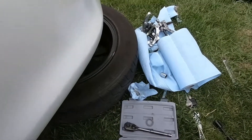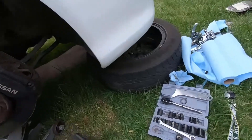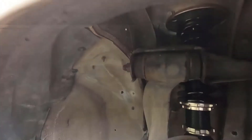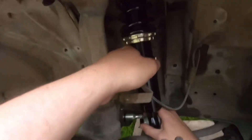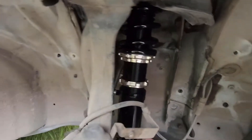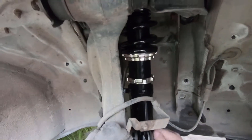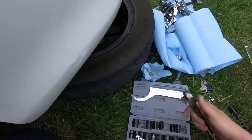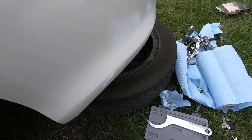Here I am installing the rear of the bottom — loosened it enough for maneuverability. I'm looking for my 17mm, thread it on by hand first, then go at it with a ratchet. You'll want to torque those down — I think they're supposed to be upwards of 100 foot-pounds or more. That's a priority for the bottom of the suspension. Make sure it seats correctly; it only fits one way — if you try to put it in backwards it won't connect.